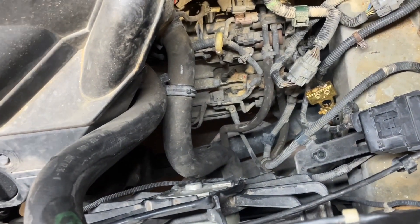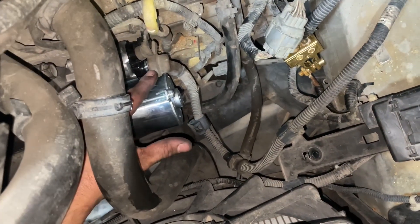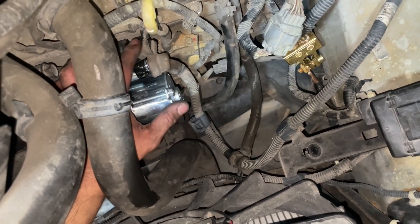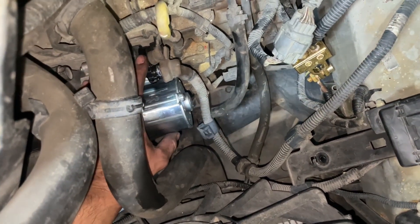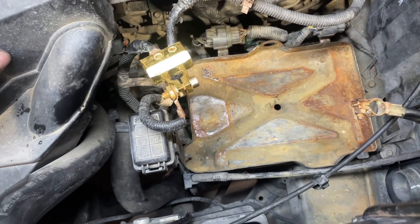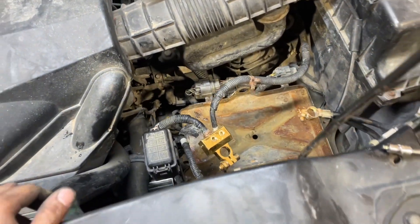You took it out, so you know how to put it back in. The two 17 millimeter bolts are installed, the 12 millimeter nut for the power wire is on, and the sending wire is pushed in and clipped. Now let's put the battery tray back in. These are pretty much installed now — just gotta put the battery back in and start the vehicle. Thanks for watching, please like and subscribe, more videos to come.